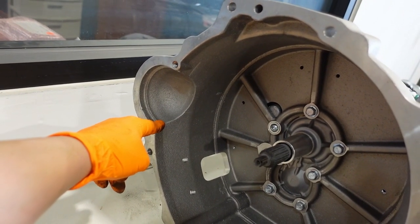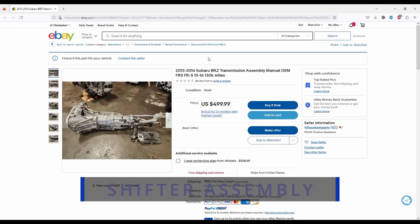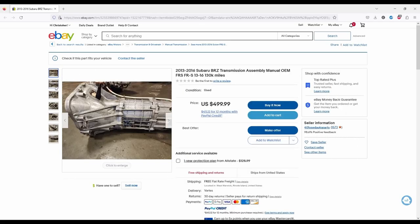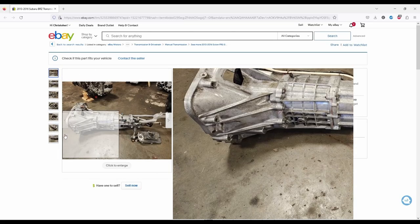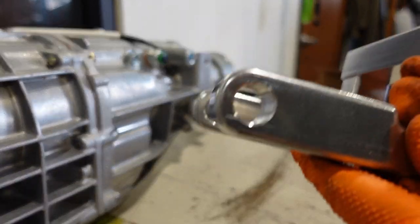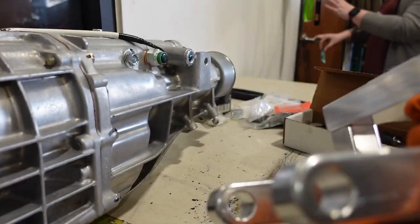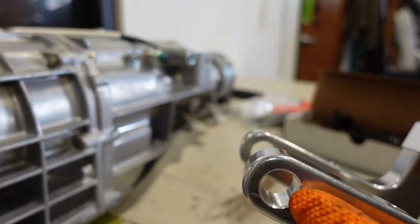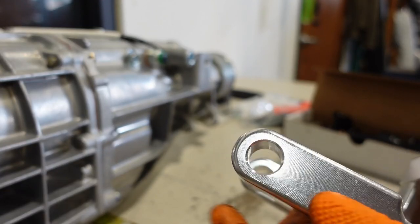After trimming your shield, your starter will bolt directly to the bell housing. Moving on to the shifter assembly install — if you're using a used transmission and it came with a factory shifter assembly, you can remove the bushings from the old bracket and reuse them on our new bracket. Our video will specifically cover our complete kit, which features the Cusco Delrin shifter base bushings. You can see a slight chamfer added to the bore entry so it doesn't snag during install.